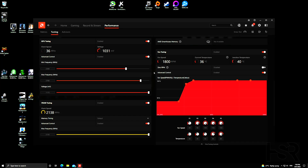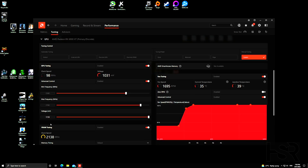If you're interested in undervolting, here's what to do. Once you've found a stable overclock, start undervolting. The only thing you need to touch is the voltage slider. I know my safe undervolt range, so I'll apply a small undervolt, then go back to Kombustor and run another stress test.